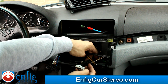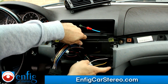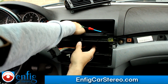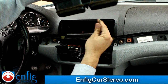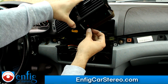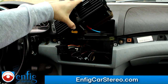So we have one, two, three, four connectors — all four are visible. I'm going to grab this big thing and bring it up top to keep it out of the way. Now putting this back in — do the little green loop, push this back in, and the metal clip. Make a huge mental note for the metal clip — in about a third of the ones I've done, I've had to take it apart again because I forgot the metal clip.